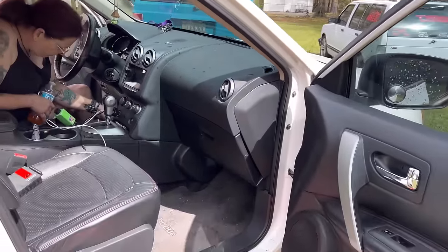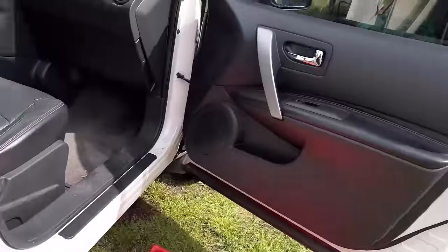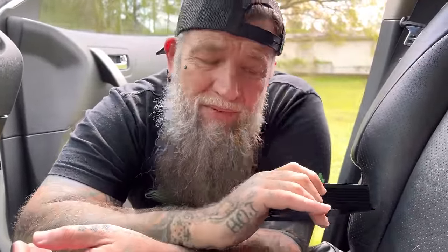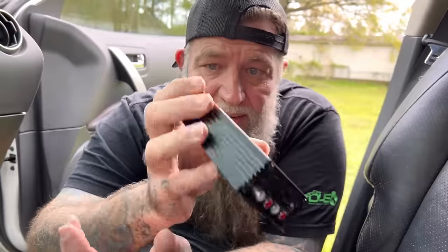It's Saturday, and it finally stopped raining, though it's been raining all morning and the ground is wet. I'm fixing to get in here and wire this micro amp up. I tested it at 16 volts and it did power on and not protect, but that doesn't mean much — I've tested an amp that did fine at 16 volts until you plug RCAs in and put speaker loads on it, and then it wants to protect from voltage. So I'm hoping this one doesn't do that.